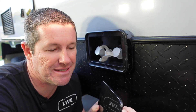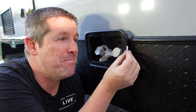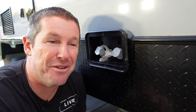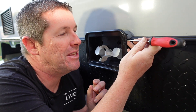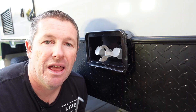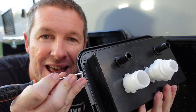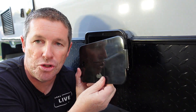These pins slide into the side of the door and in through the back of the assembly. The pin may shear off and get stuck in there, or if you're lucky it'll just fall out — that's why you get a pin with the replacement door. If the pin is stuck in behind, you may be lucky enough with a small flathead screwdriver to flick the pin up and release it. The best tool is a pick, which allows you to get in behind the assembly and flick the pin out.